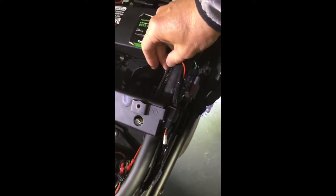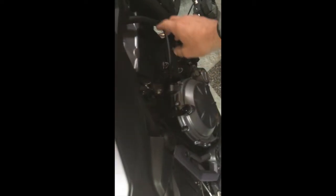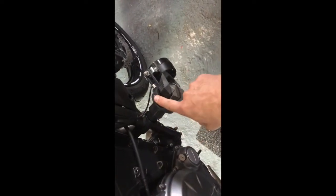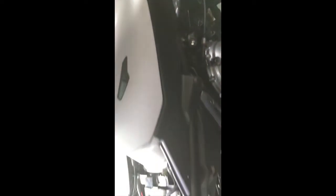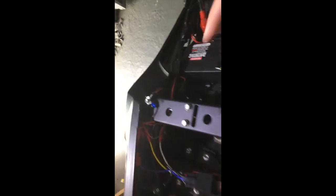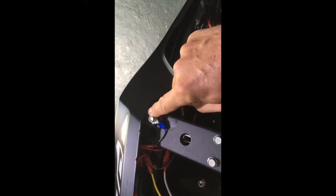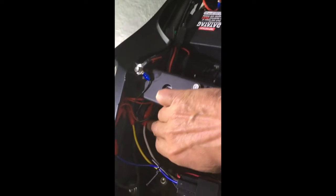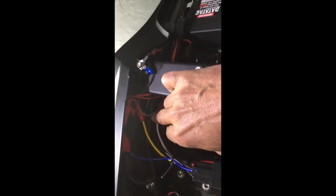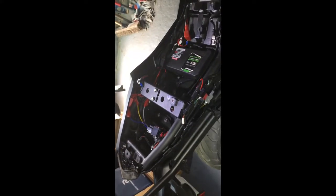For the bike itself I bought cable as opposed to wire so it's already sheathed. It's black so it's easy to hide. I ran it behind the plastic, behind the radiator, down to the brackets which are connected to the lights. When I started doing it I was a little bit daunted but it really isn't that bad. You can see an earth terminal where I've got all the negatives bolted to a bolt connected to the chassis. My positives are all taped up, double insulated, and fused of course as well. That's pretty important - you put a fuse in there to stop any potential electrical fire if something goes wrong.